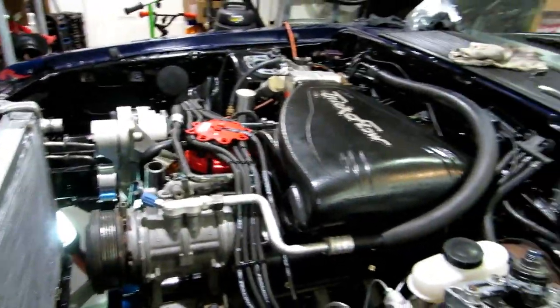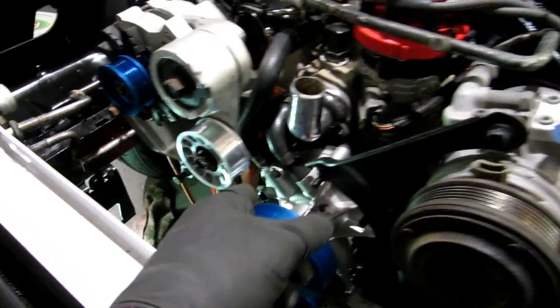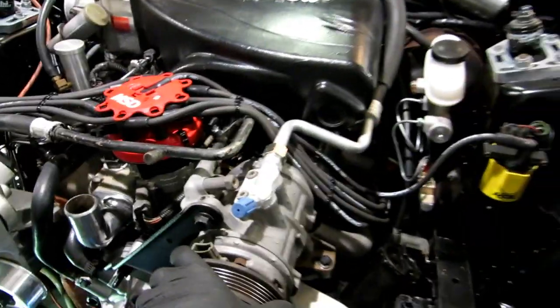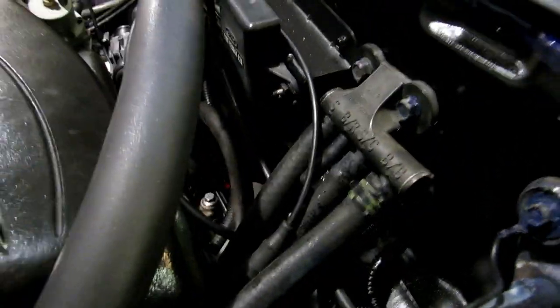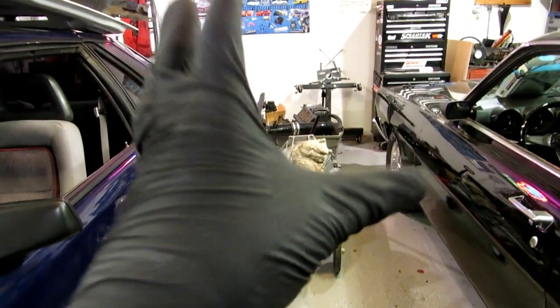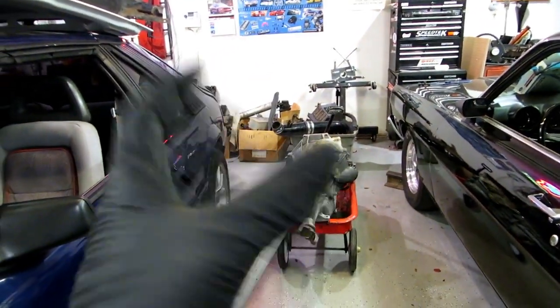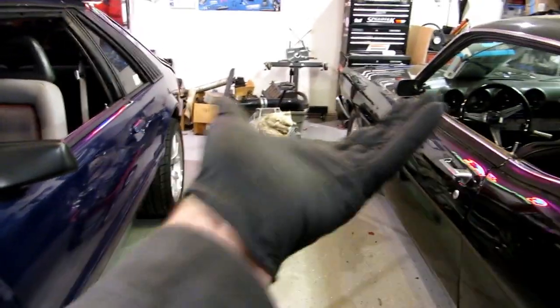Right now what I want to do before I bolt the motor down is tighten things up, because right now it's held in by a tie-down strap just holding it kind of in place relative to the transmission and drive line. It's actually really handy having it loose so I can move the motor back and forth - it lets me get to those bolts in the back for the bell house. I think what I'm going to do is take the bell house off, hook up the clutch fork and new throw-out bearing, and try to get it slid on and bolted into the back of the motor, so when it comes time to put the transmission in, it's just a matter of stabbing it in place.